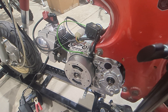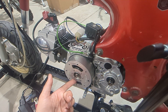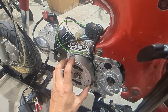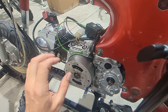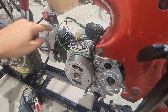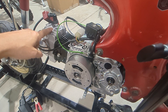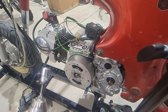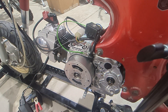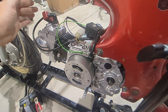The flywheel is installed and torqued to spec. This is going to be the initial test to see where this particular kit is firing. The variables are basically how they are assembling their two-piece CDI stator plate system and the strength of your old magnets on your flywheel — that will affect where this fires off from the factory setting. I pulled my spark plug and I'm grounding it up here on a fin. Two reasons: you can observe the spark visually, and it reduces engine compression since the plug hole is open. You can then use a non-impact drill counterclockwise to spin the flywheel through the nut and generate a spark. I'm using a timing light, and you want to make sure your inductive probe is as close as possible to the spark boot to get the best reading.